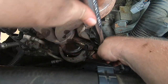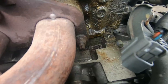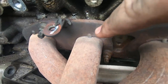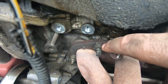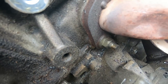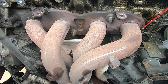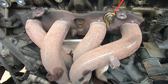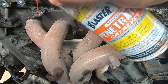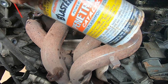The next step I did was remove the O2 sensor — I reused my O2 sensors since nothing was wrong with them. They looked good, still performed good. After you get the O2 sensor off, work on the five actual bolts that hold on the exhaust manifold. I sprayed it with a little bit of rust penetrant — the bolts didn't need much, they didn't look weathered or rusted at all, just dirty. Spray rust penetrant on all five.